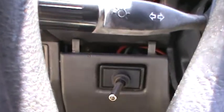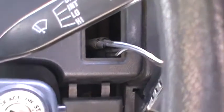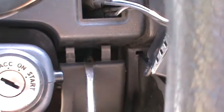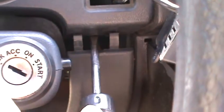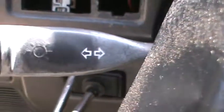You can see that I've popped the two little pins out on that side and on that side. All I did was I got a flathead screwdriver, put it into the gap and levered it up and down really smoothly. Just do it really smoothly because you don't want to snap these off. They're only plastic. Same with the other side.